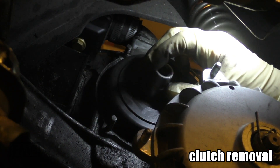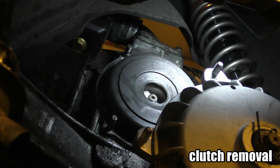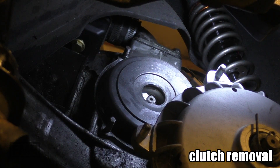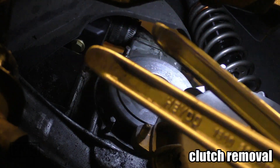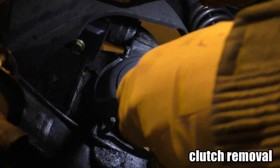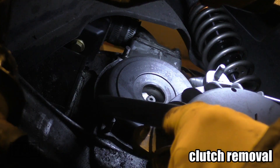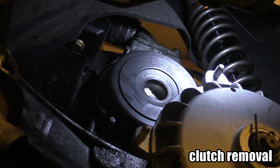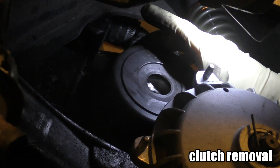I should wear it by hand now. I'm gonna take this beauty out. Usually it does not slide out by hand — oh, it does! These iron thingies — tire tools for removing tires from the rims — it's very practical. This end here: you can use it if a clutch is stuck. You can use it to remove the clutch gently, because a smaller screwdriver would damage the engine case here and here. You just go, rattle a little bit on both sides, and it comes out. Don't do that too hard with too much force, because the clutch may open.